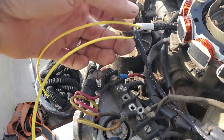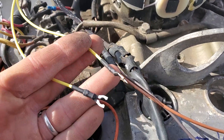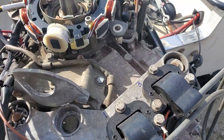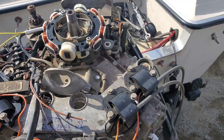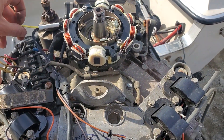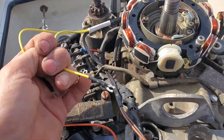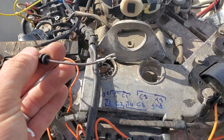If you follow up here, you'll see there's yellow wires — what do they do? All these wires are for is to charge your battery. Nothing else. Two-strokes don't need a battery to run. I can crank this over with a starter, disconnect the harness plug, and this thing will run on its own — it makes its own electricity, it's a completely self-contained unit. All the yellow wires do is charge your little battery so that your fish finder can keep working and you can crank the motor over. It doesn't even need these to run. It needs the stator charge wires to run — these two guys are creating the power for the spark.